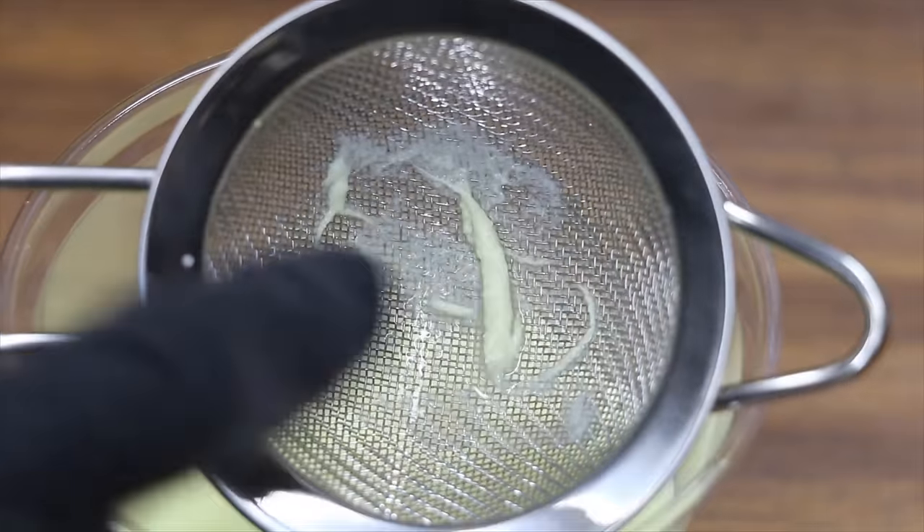With Multi-Seal, there's a slight change in color on some of the steel — it's hard to tell if this is rust or just discoloration. There appears to be surface oxidation with Tire Eject, and after cleaning with water, there does appear to be some surface rust starting lower on the steel. Tire Eject is also sort of hard to clean up — it leaves a coating that doesn't want to come off with water. As for ease of cleanup: Multi-Seal is easiest, then Tire Slime, then Fix-A-Flat, and finally Tire Eject.